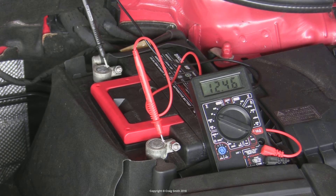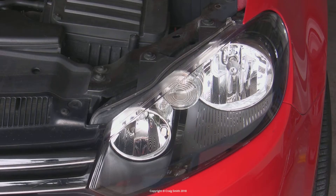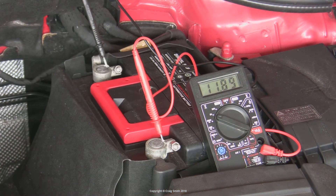On to checking the battery further. Whether the battery was most recently charged from the alternator or mains power, you need to remove what's called surface charge — chemistry that gives it a sort of fake voltage reading. You can do that by letting the battery sit for a long time, up to a day. But if you don't have the time, just turn on the car's headlights and let them run for about five minutes, and then you'll be in a good place to use the voltmeter.